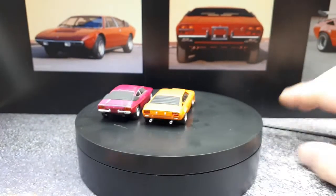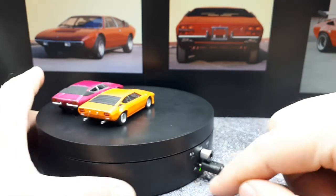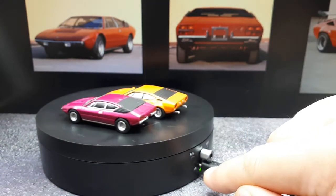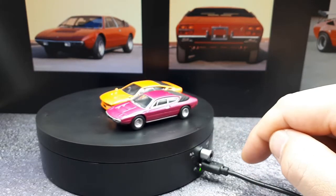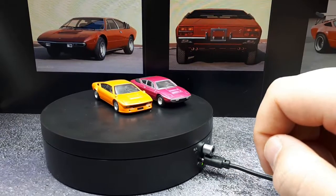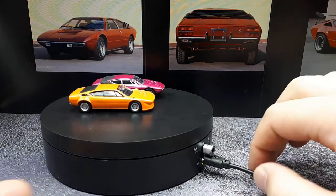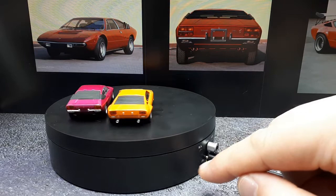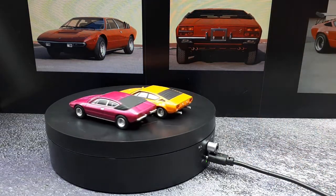I gotta tell you guys, this turntable might not be a good purchase. I had glued this on to make the power button easier to get to. There's a USB cable here — I have an 18650 rechargeable battery in this, but this thing will die on me. I don't think it's actually charging my battery. I took the battery out and tried to run it — it won't run without a battery — but if it doesn't charge the battery, what good is having the USB? Is it just my bad luck or is it a poorly designed product? Be mindful of that — there are tons of these on AliExpress. They have three buttons and three speeds, and can take triple-A's or an 18650. I currently have rechargeables in both banks to see if this thing will die on me.